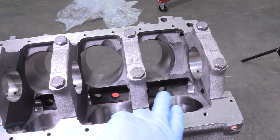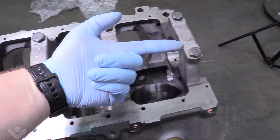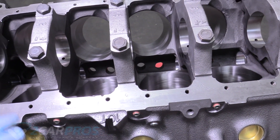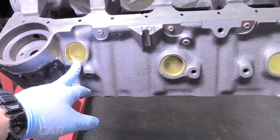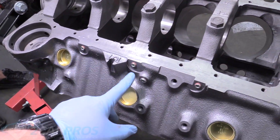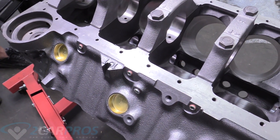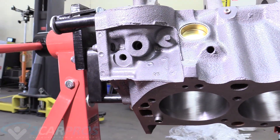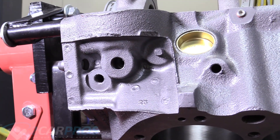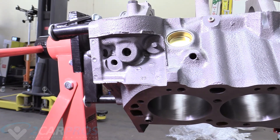The caps here for the crankshaft are actually torqued down to factory specifications in the correct order. They put a line bore through here and it needs to all be torqued down so that when you torque it down with the crank in here, it's all circular and mated together correctly. You also want to make sure they put in new freeze plugs on each side — mine are all brand new. The oil gallery plugs need to be in place as well, because even if one is missing it'll leak oil everywhere. There's also an oil sending unit down here that tells your dash how much oil pressure you have.